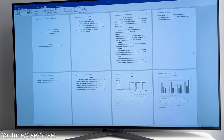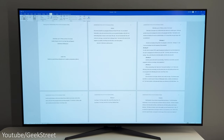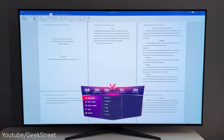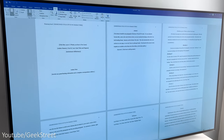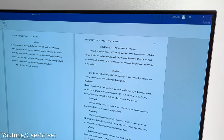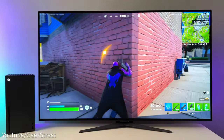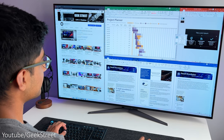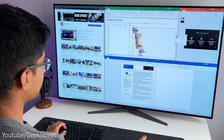One negative point is the screen dimming. When there isn't much change on the screen regularly, the screen will gradually lower its brightness, then when you change to another window the brightness pops back. This happens when using one static app like Word, for example. The brightness isn't so bad that the document becomes illegible, and it doesn't happen when gaming as you'd generally have a lot more movement on screen. LG have put this in intentionally for burn-in protection and it can't be disabled. The monitor also doesn't support picture-in-picture.